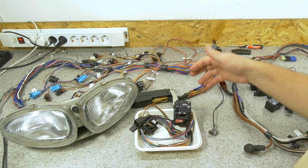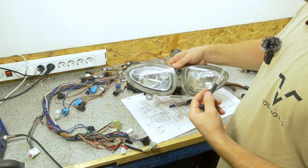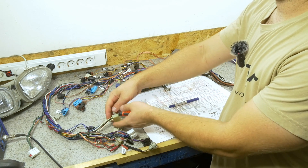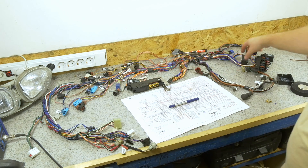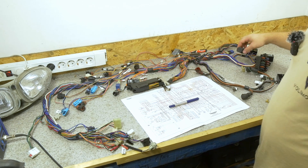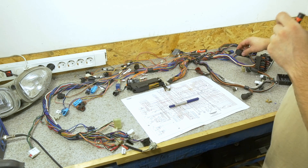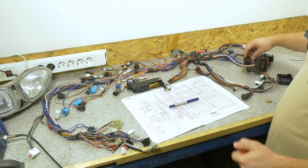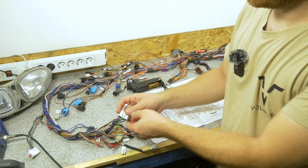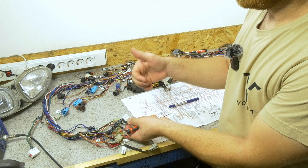This can be fixed with a few small modifications. The bike has two headlights, each equipped with high and low beam. When you turn the ignition switch, which is connected to here, there's power going to this relay here through the fuse box. What this does is switches off the power to the lights when you're trying to start the engine, so all power can be concentrated to the starter motor. But when that's not the case, you get the power feed directly to this connector, which is your physical switch for your light.